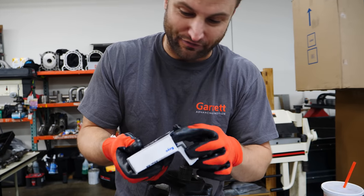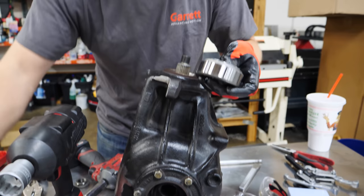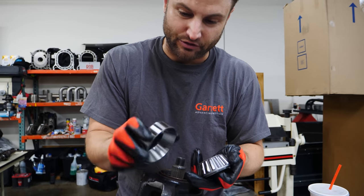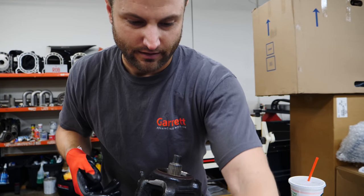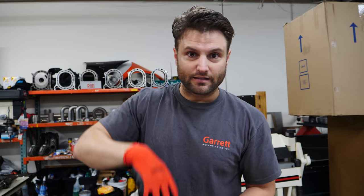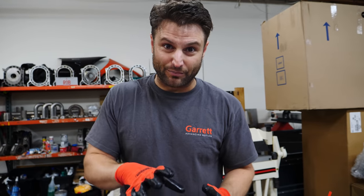I was a little worried when I pulled that first one out, so we're going to go ahead and take a look at each of these. Sure enough, this one right here is the one that will go in here. This piece actually threw me off — I was like, why do I need a new one? But it's all meant to work together. It ends up being more work because now all of those pieces make a couple thousandths of a difference. So this pinion is now no longer trussed; we don't know where it is in three-dimensional space. I'm going to spend a lot of time assembling, disassembling, assembling, disassembling just to get the position just right.